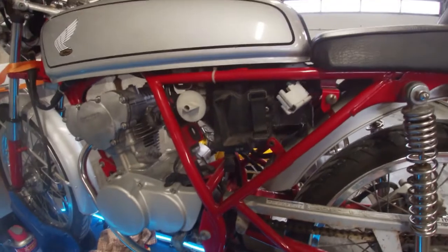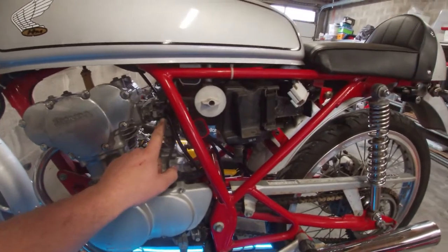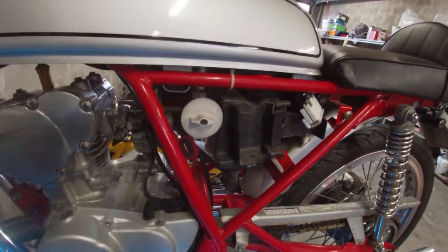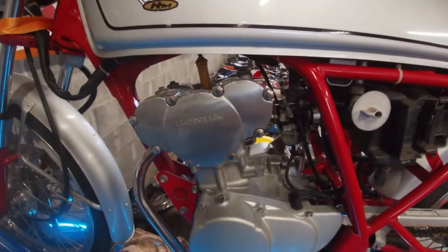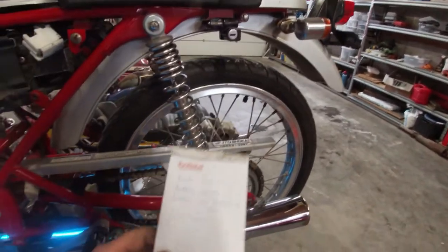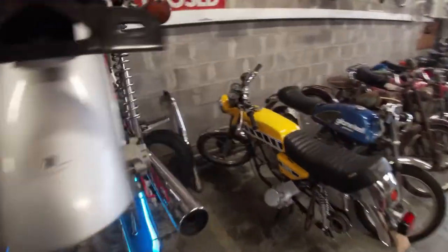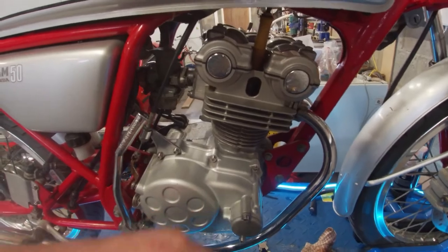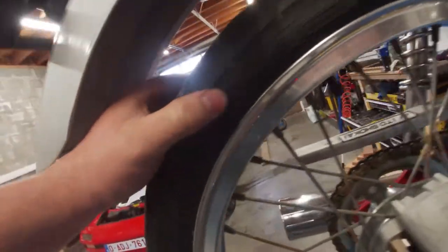Other than the battery, we're going to give this thing a good overhaul: fresh oil, carburetor clean, check the air filter, maybe check the fuel petcock as well, and a general cleanup. I've started making a list of parts to order — tires, battery, spark plug. There's also an oil filter cartridge on this side, I think it's just a paper oil filter. The tires are completely dry rotted.